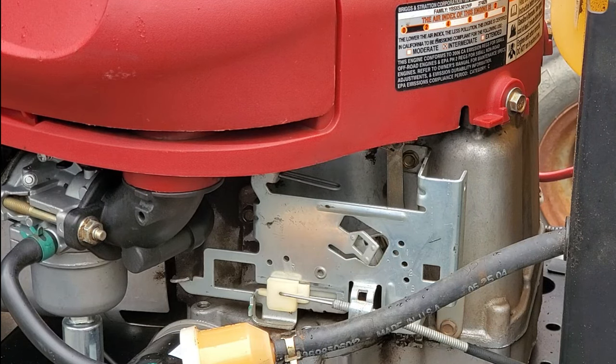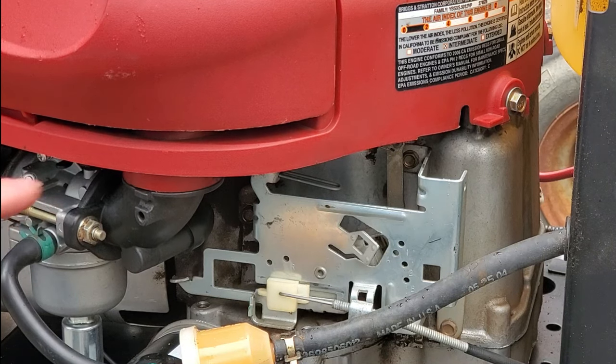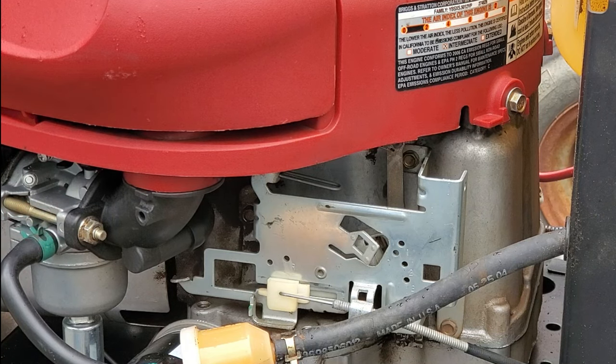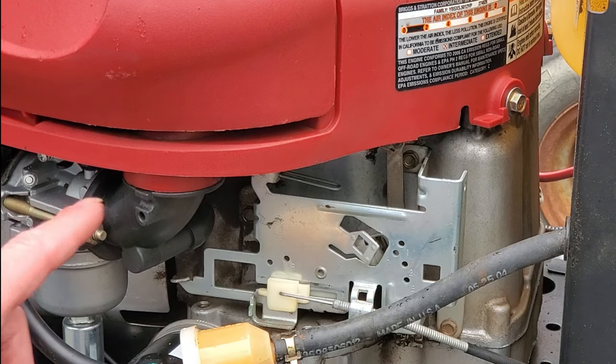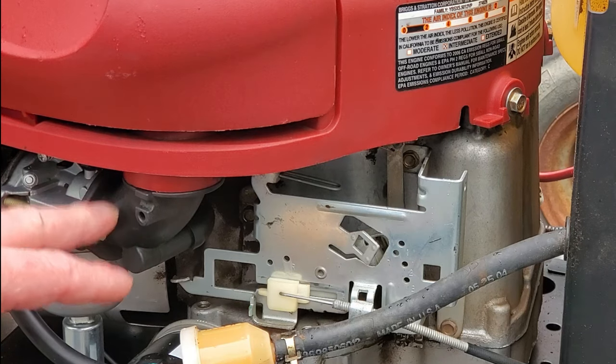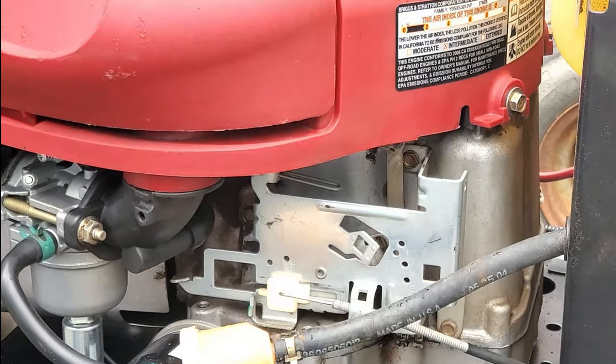Welcome back. In this video we're going to be looking at our choke. The choke does not release when you put it on after you start it — the choke does not come off and the engine starts to sputter. You have to take it off by hand and that's not going to work. We're going to look at that and take this piece off. I've seen before with a new carburetor that the choke rubs on something and doesn't release, so we're going to tear this apart and see what's causing the problem.